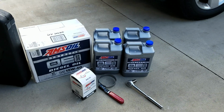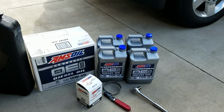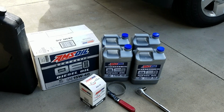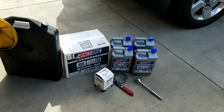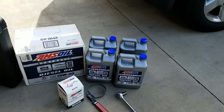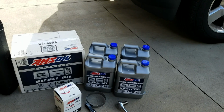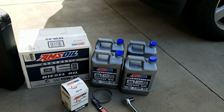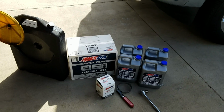I happen to have an older case of Amsoil HDOE original equipment 15W-40 oil, which they no longer make. They've improved their diesel line. I just called Darren up at Amsoil Corporate Technical Services, and he says that's perfectly fine. We're going to run it for about 6,000 to 7,000 miles, somewhere at the end of summer, and then get it out of there and put the good stuff in. Like I said, I just wanted to get that cheap oil that was in there out.